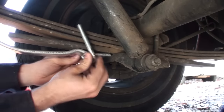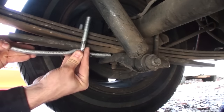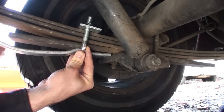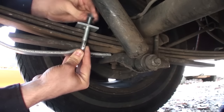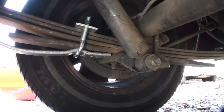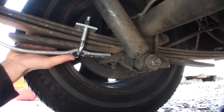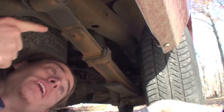The next step is just placing the U-bolt into the recess in the helper spring itself with the threads facing upwards. Next, take the plate and stick it over the holes, then your lock washers, then just hand thread your nuts onto the U-bolts. Everything is just sort of hand tightened at this point. This is the step where the instructions say to raise the rear wheels of your vehicle off the ground before assembling — that's going to relieve the tension in these springs so you can see the gaps. Then I'm just going to repeat this step on the opposite side.